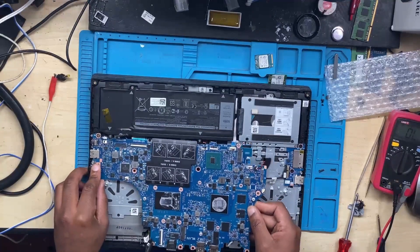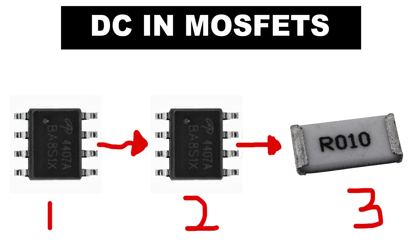Whenever you are facing a laptop that is not charging the battery, check MOSFET number one first — whether it's shorted or not. The only way to do that is to take a multimeter, put it into continuity or beeping mode, and touch both sides — left and right — and listen for continuity. If the MOSFET is working, there won't be any continuity. If the MOSFET is dead and shorted, you will have continuity because it will be allowing power to pass one way even when it shouldn't. Do the same thing with MOSFET number two — check for any continuity or short on that MOSFET.